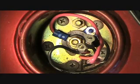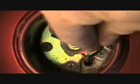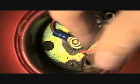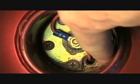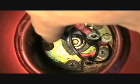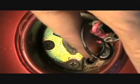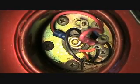Alright, with the gauge removed, it's time for a little detective work. Now if we look, these wires here go through that hole in the bottom there, out the bottom of the tank. Now it looks to me like there's some crud on this screw and down here in this hole, and you don't see the crud over here or over here or over here. So that could indicate that the gasket beneath this sender unit has a tiny leak. The gas comes up, goes into this hole, which you can see is a little bit rusty, and then drips out the bottom of the tank. Just a very slow drip, but annoying nonetheless.